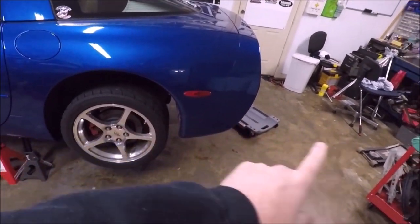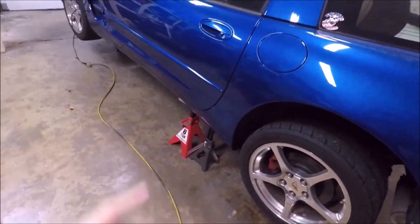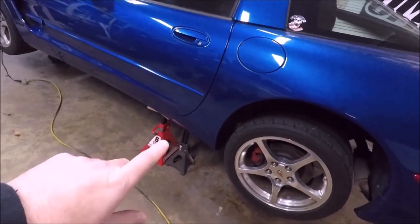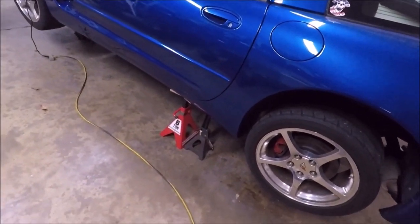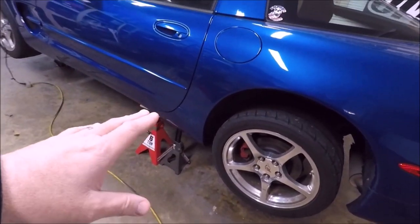I don't have pucks, I just put a piece of cardboard — they're not hurting anything. These extra jack stands aren't even touching anything; they're just a safety in case the main ones fail. If you do have a set of quick jacks, those would be pretty good for this job too. They're not great for transmission removal when the trans is up front because they kill your side access, but since we're primarily working from the back, quick jacks would be perfect — though I don't have two grand to spend on them.